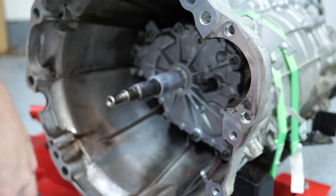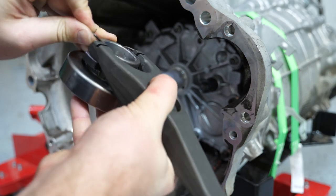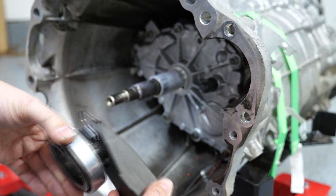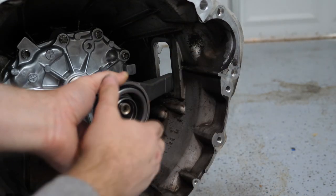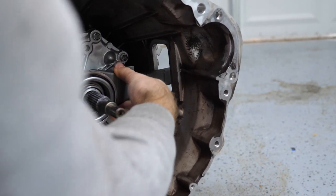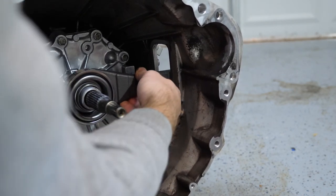So now that tab is in place and we've got this tab on here as well. We're going to go ahead and assemble the fork and the collar together simply by pulling up on these tabs just high enough so that you can slide it over and onto the fork. The full assembly should look something like this — that clip is holding the fork in place so it doesn't move around too much. So now we're going to install this in the transmission. Situate the back of the fork towards that port on the side of the transmission, slide it over the collar, and mate it up against that pivot ball bearing. If you give it a good push it should sit properly, and now your fork shouldn't physically move too much — it should be pretty tight on the pivot ball bearing.